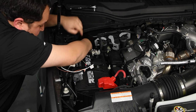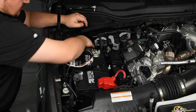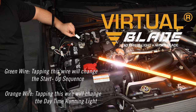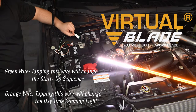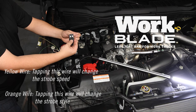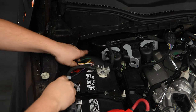The rest of your wires don't require any permanent installation and are just to set styles like startup sequence and DRLs, or for the work blade strobes pattern and speed. This is done by tapping them to the ground. Once satisfied with your selections, collect all of your wires and bundle them up with a zip tie and hide them.